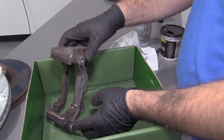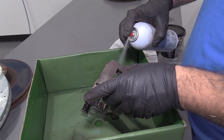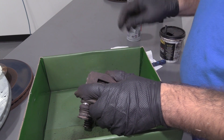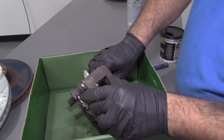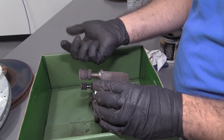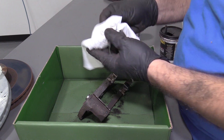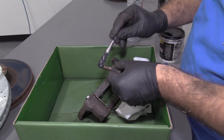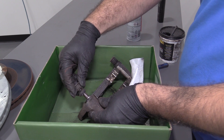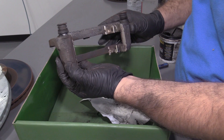Normally you could totally reuse this bracket and these clips — these are stainless. You could leave them in, clean them with some brake parts cleaner, a wire brush, and a rag to make them nice and shiny, and you could totally reuse them. I'm going to replace with a new caliper bracket because these are also ripped where the slide boots are. The other thing you would do is take these slide pins out, clean them up, apply some new caliper grease, put them back in place, make sure they move freely, and put the boots back on. Since these are torn and dry rotted and we're replacing the whole caliper anyway, I'm not going to worry about it — but you can reuse them if they are okay on your vehicle.